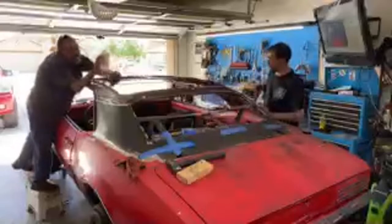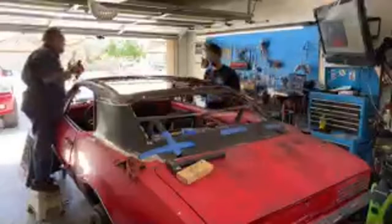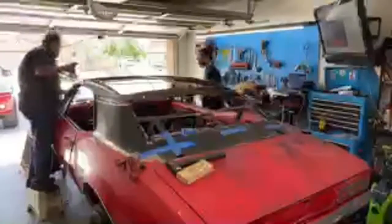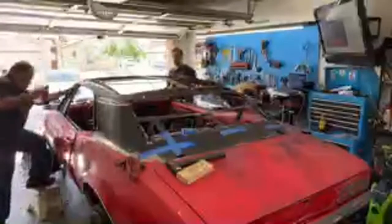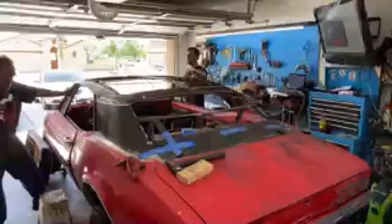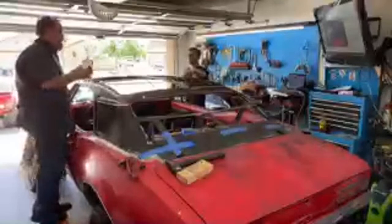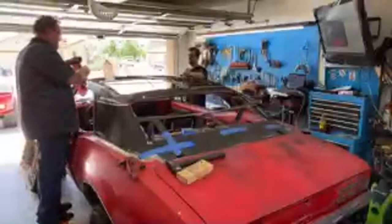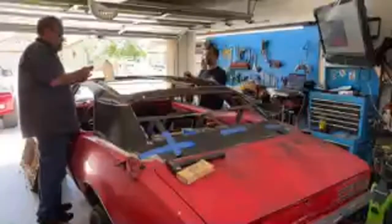That looks good. The metal cleaned up nice. We just clean the metal with a wire brush, that's our routine. Now, there are some people who actually sandblast this completely back to 100% bare steel, and then epoxy paint it, which is great. I don't think there's anything wrong with it. It's definitely going to last, but it's made 50-some years with no roof on it.